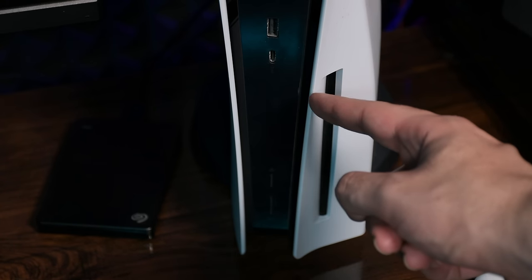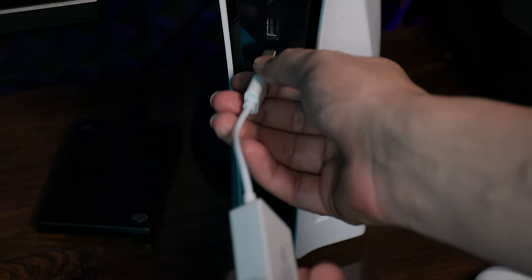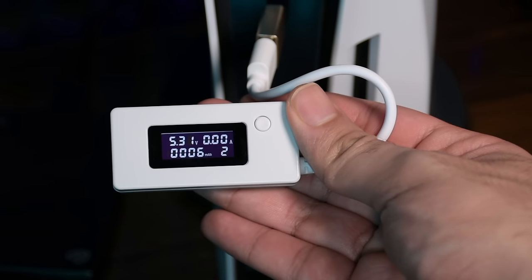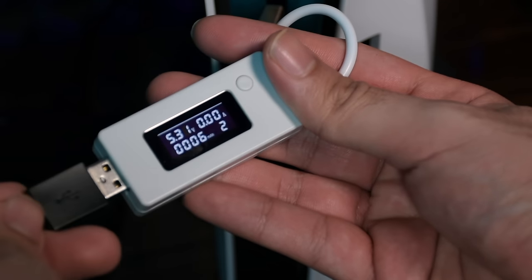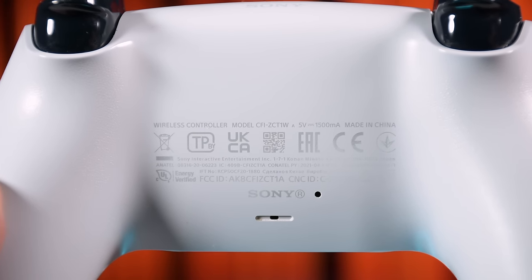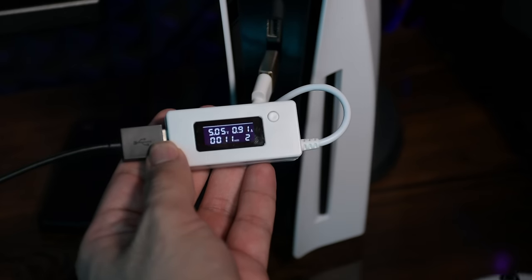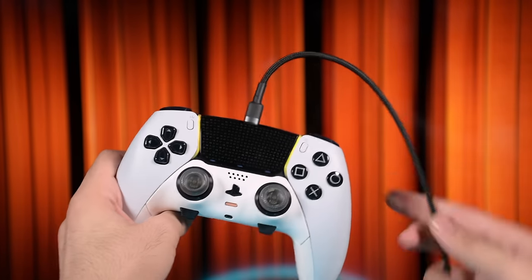There's an update regarding the USB-C port on your PS5. I have a new tool where I can check USB ratings for any device. Some people worry the USB-C port may hurt their controller, but based on my tests the input voltage is 5V and the current is adjusted by the controller. The input rating for DualSense and Edge is 5V up to 1.5A, so you'll be fine. You can get a Type-C to Type-C cord and use the front Type-C port if you like.